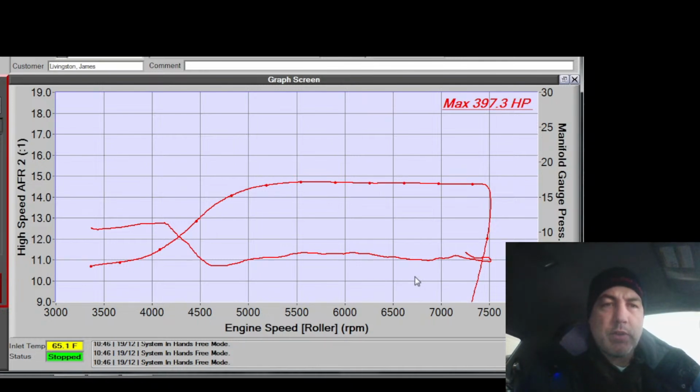So I'm just going to go straight to the wastegate duty cycle tables, which are set at 0. So gate pressure is giving me 17. Wow, okay. Alright, I'm going to put this right at 20. 20% at the gate should give me like 3 or 4 pounds maybe, depending on how the gate's set up. It should be set up appropriately for this car. But I'm going to hit 20 anyways, and we'll see how she behaves.